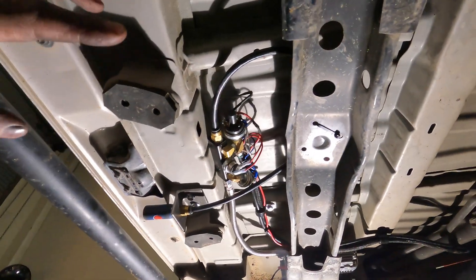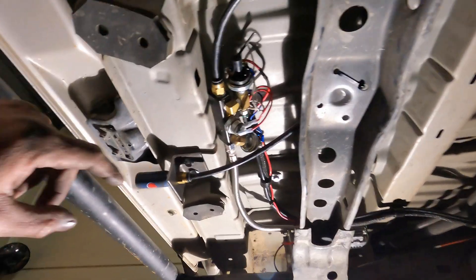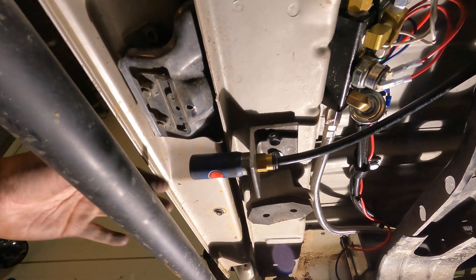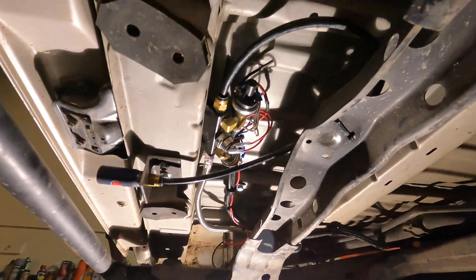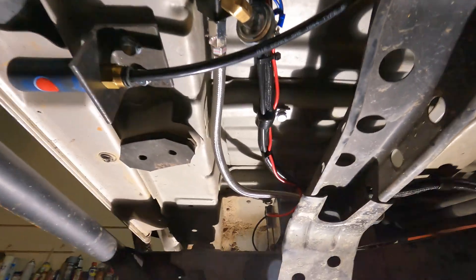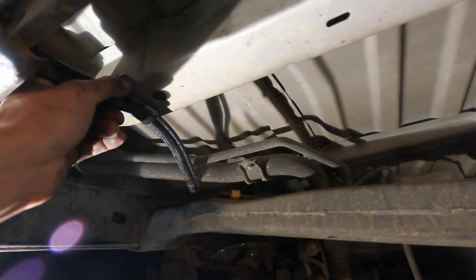The rear is all done. I have this extra wire here in case I want to run two compressors down the road. I got my chuck mounted here — this is the tailgate, so you can access it with the tailgate open or from underneath. Three-eighths airline here, a couple switches, I have my quarter-inch drain line going forward, air compressor is all mounted, ground is over here — just super easy. Everything's attached and looking nice. Now I need to move forward and mount the dump valve, the MAC valve, and after that it's just the relays and hooking up the switches.